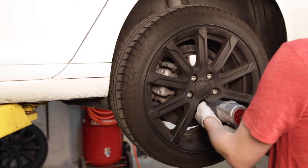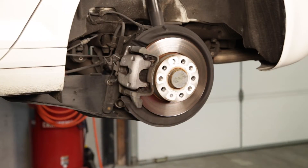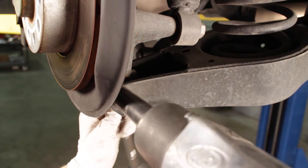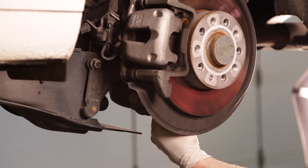To begin the rear, remove the rim from the vehicle. Next, you will remove the bolt and nut holding the lower control arm to the rear hub. Keep in mind that the spring will now be unloaded, so take caution in lowering the control arm.